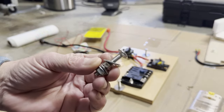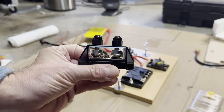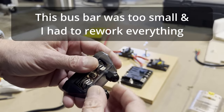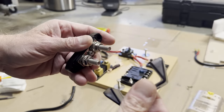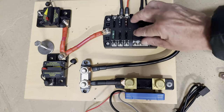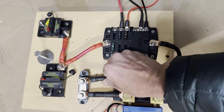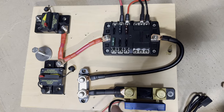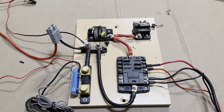I started building up too many connections on my common ground bolt, so I swapped things over and I'm adding a two-spot bus bar. These nuts hold the cover in place and you've got the connections right here. None of this stuff is actually screwed in yet other than my shunt and fuse box — I do that so I can test the wire size after cutting it and still have wiggle room for optimal placement. When working with big wire it's a lot better to not have stuff screwed down first and just know generally where you want to put things.